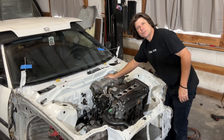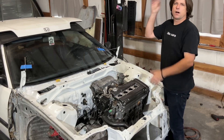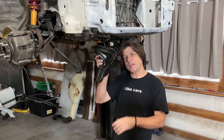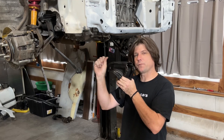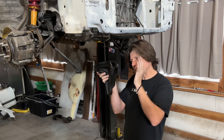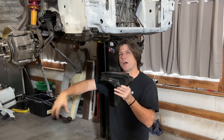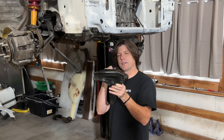Driver's side and passenger's side engine mounts are in. The engine is rocking because there's no rear mount, so I lift the car and install the T-bracket. This rear T-bracket is a factory Honda part. I snake it up around the back and pop it over the mount on the crossmember. I prefer to align that rear bolt first, then rock the engine to align the front bolts to the engine — it's much easier to align the front bolts since they're more accessible.